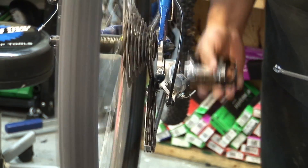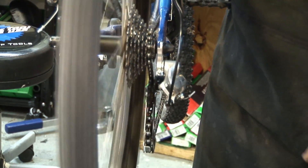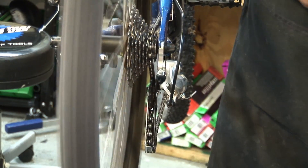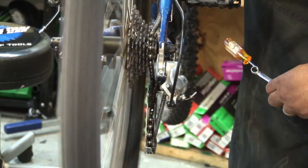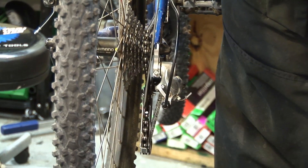So now I'm going to pedal. As you can see, I've dropped down to the lower cog. But as you can notice as well, I haven't dropped all the way down to the lower cog — coming back to that issue where we need to make that adjustment with our high/low limit.